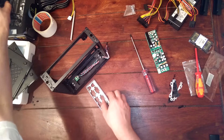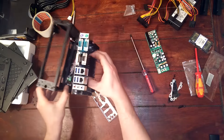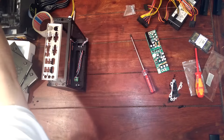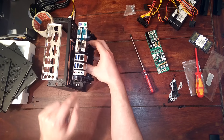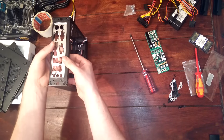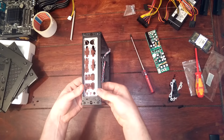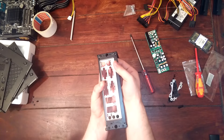First of all we need the back panel. Here it's best to use the mainboard to guide alignment — place it like we want to insert it, then make sure it's properly aligned so those two align with those two, and those three with those three. We simply push it in from the back and make sure it makes a small sound when it's locked in place.